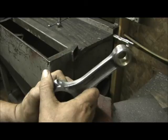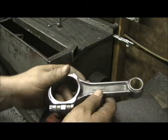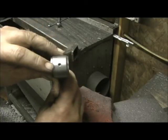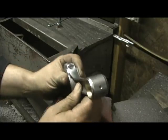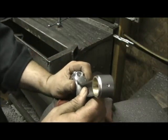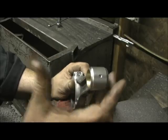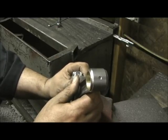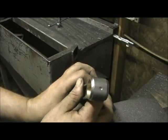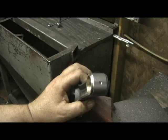I like overkill in my bottom ends a little bit. Just wanted to show you one of my little tricks — how I go in there and make that hole radius a little bit better. It's just attention to detail, like drilling the block out, getting the oil passages better, grinding the block. It's all this stuff you keep doing that adds up and makes for a good, secure bottom end. Go ahead and complete this, and I'm going to show you the rest of the finishing we're going to do on the block.